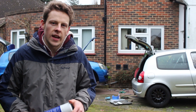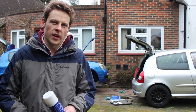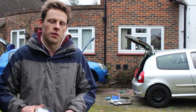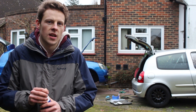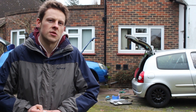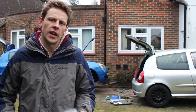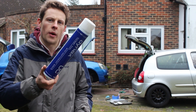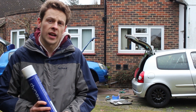We just finished fitting the kits to the car, which took about two hours in total — which wasn't too bad. Luckily everything came off pretty easily because we had loads of copper slip on everything beforehand, so that is a real treat when you're doing a job like this. We're quite particular about how we did it as well. We put some corrosion inhibitor — we've got some ACF50 and some of this Dynax, Dynax UC — to protect the bottom ball joint carrier against any corrosion.